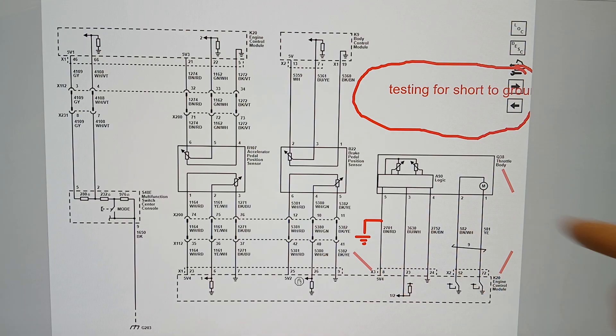If the X3 connector at the engine control module is still plugged in, you're going to get some resistance reading to ground that makes you falsely think you have a short to ground in that circuit. Then you're chasing your tail — running in circles, possibly concluding you need to cut the wire harness open and hunt for a chafed wire shorted to the engine block or cylinder head. Let's test this on the car and see what kind of reading we get, first with the ECM connected.